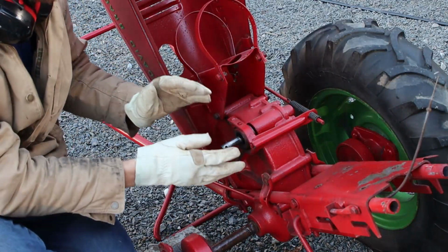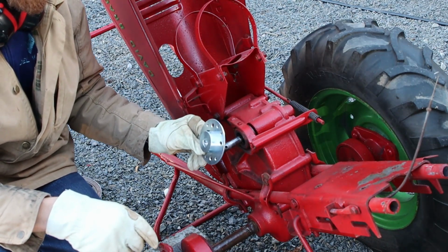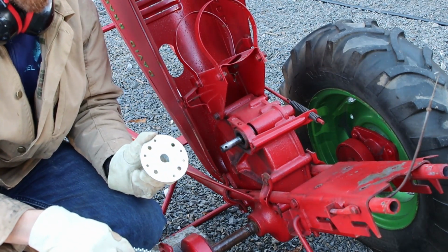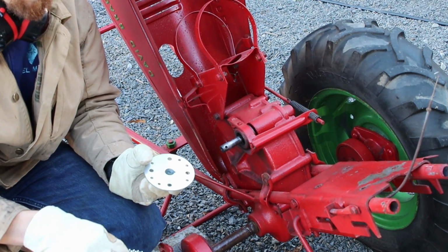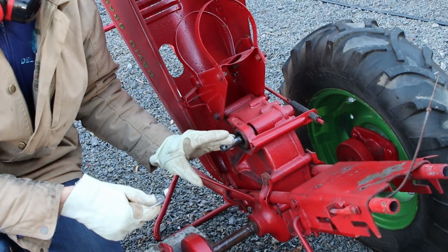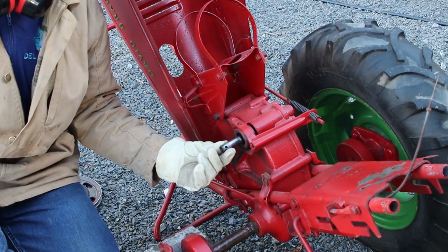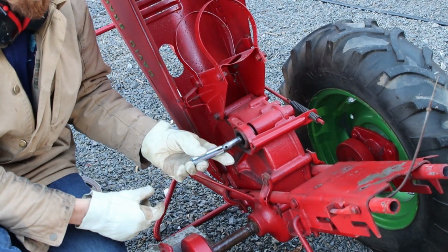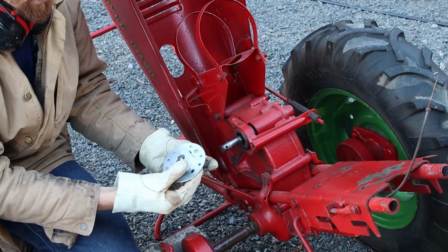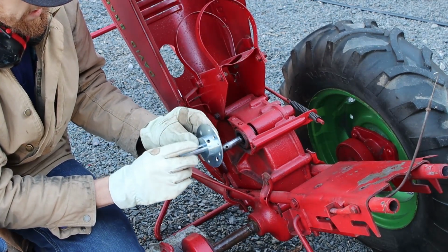So now that we got the pulley assembly off this shaft, we want to use this shaft to sprocket adapter. Now, when I originally ordered this, this is the wrong size for two different reasons. The first reason being, when I measured this shaft, the assembly was still on here, so I thought this was a 5/8. This doesn't look like a 5/8, and it doesn't quite look like a 3/4. This is a 5/8 to a 3/4 sleeve. My intention was to put this sleeve over the 5/8 inch shaft, then put that on through our sprocket assembly here. That would give us a nice tight fit.